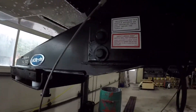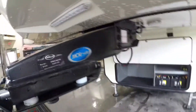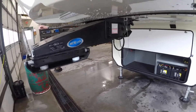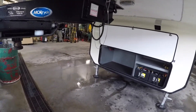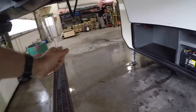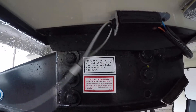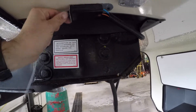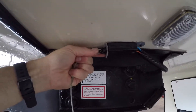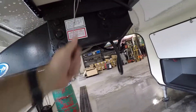Next we'll come to the nice loading light and your breakaway control. The breakaway control will engage the brakes of the trailer if you become detached from your tow vehicle. The tow vehicle pulls away, pulling this pin out, and then the brakes are engaged. If it's not towing right and the brakes seem stuck on, it could be that the pin is pulled partially out, so just make sure it is in where it's supposed to be.